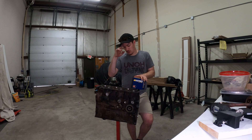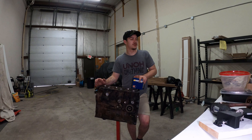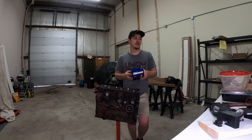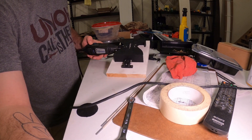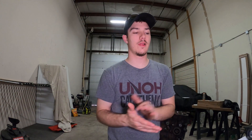I'm honing the cylinders already with a 300 grit straight stone hone — a three-stone hone. That's basically just sizing for the piston rings. It's kind of a tedious process. As you can see, I 3D-printed a piston ring filer since I don't have a hand crank one. It works on a Dremel with a diamond blade, which I already have.